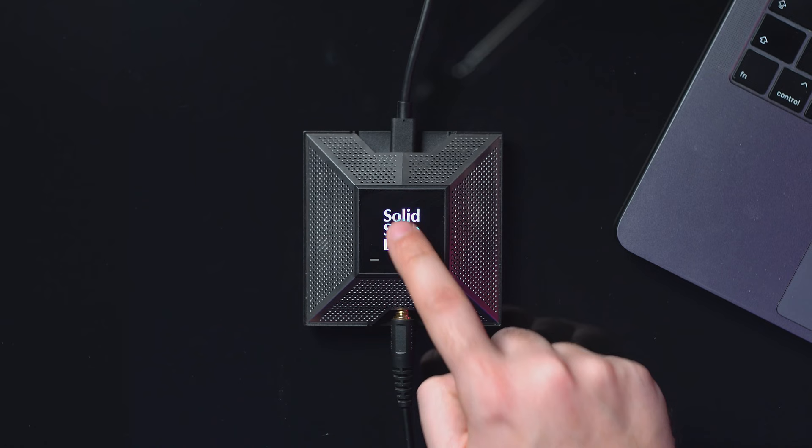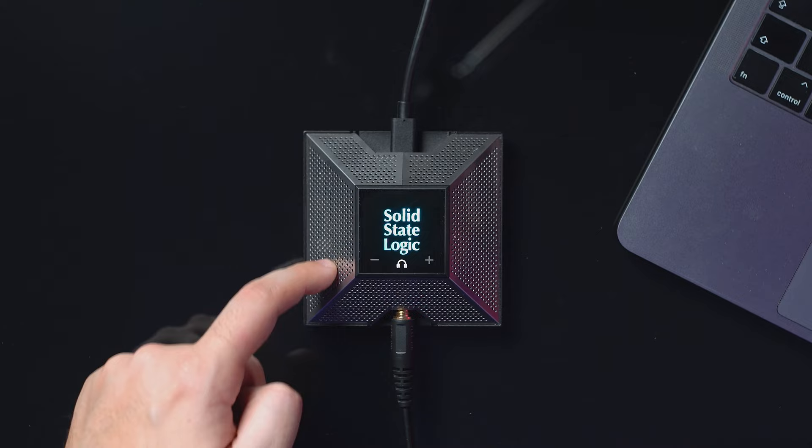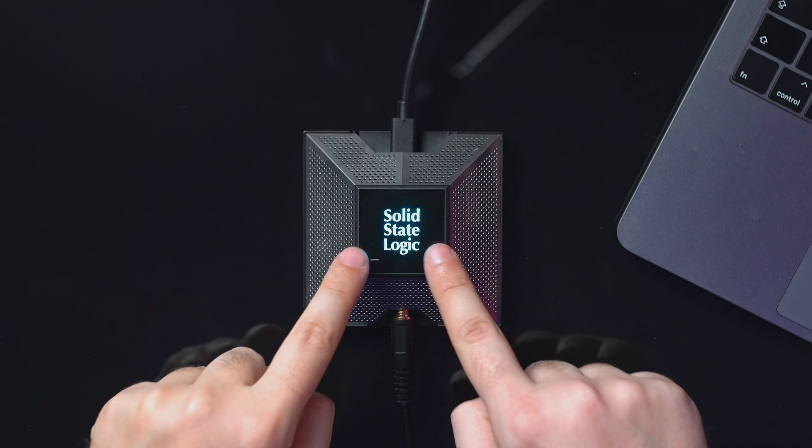The equalization is different in Vocal mode — it emphasizes the mid frequencies of the voice. Now changing again, we have the fourth mode: Music mode. As you can hear, it's quieter. Like Vocal mode it has stereo output — watch this video with headphones to hear the difference — but since it's designed for louder musical applications, the preamp gain of the capsules is lowered.